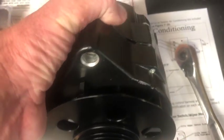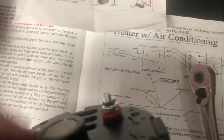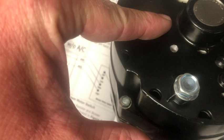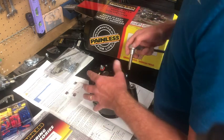I pulled the alternator back off. When you're looking at it, it sits like this in the car — basically up like this — and that bolt is facing up near the engine where you can't get to it. I need to get to this other one, which is down in a tough spot. So what I'd like to do is clock it out. With these CVF alternators, you can just pop these four bolts off or loosen them, then clock the backside to where it needs to go.